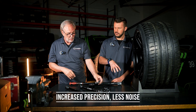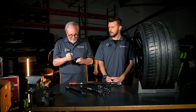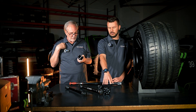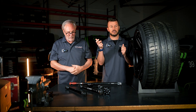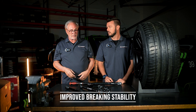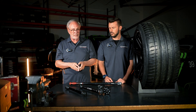You gain the precision without the total noise increase of a ball joint. These bearings also have a lot of preload — the nylon takes play out of them so the ball joint doesn't make popping noises when you hit a bump. What you'll feel as a driver is the steering wheel translating every piece of information from the road to your hand, almost like you think to turn left and the car starts to move left — it becomes very intuitive. For braking stability, the big rubber bushing allows caster to change as you hit bumps while braking hard and the car snakes. This takes that play out so when you brake, the car stays straight.